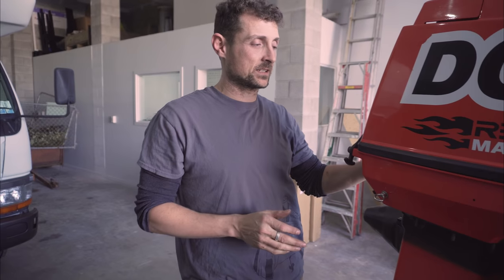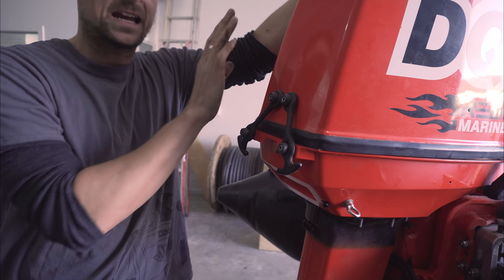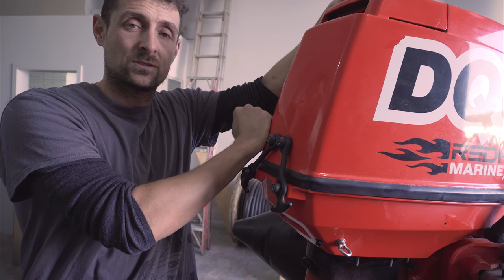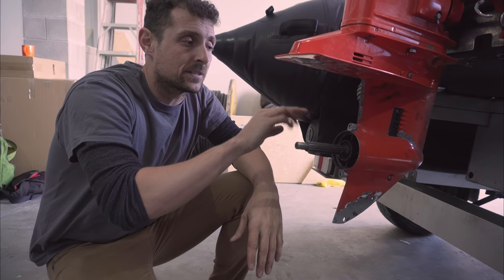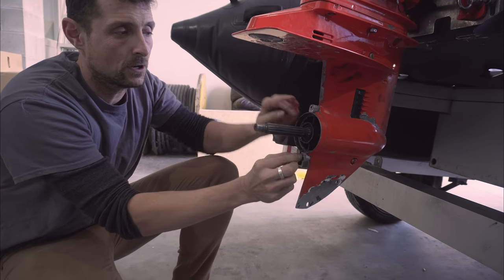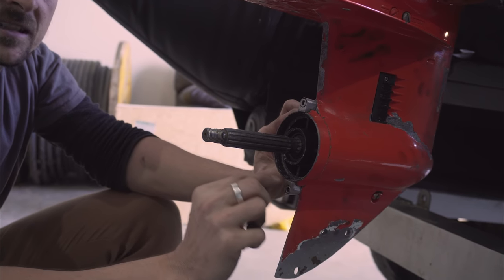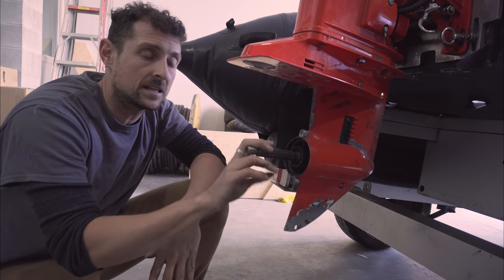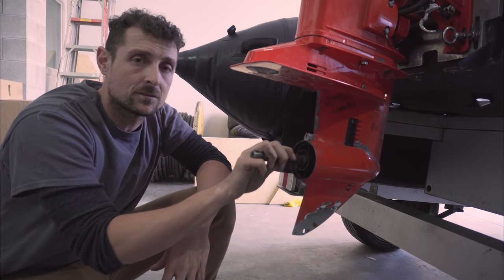My recommendations for internationals: first, change out the standard fitting for your cowling and put straps on to hold it down. Cowlings can and do come off regularly — once they come off they sink fast and they're worth about $800 each, so it's worth a few bucks to strap it down. Next, on the gearbox, this housing normally has two bolts — one top and one bottom — and those bolts can come loose and can crack the housing. It's worth checking that between every race day to make sure the bolts are tight and there are no cracks. I've seen plenty of gearboxes come flying out, mostly from very rough driving, but it's not worth losing a propeller just to skip checking those two bolts.